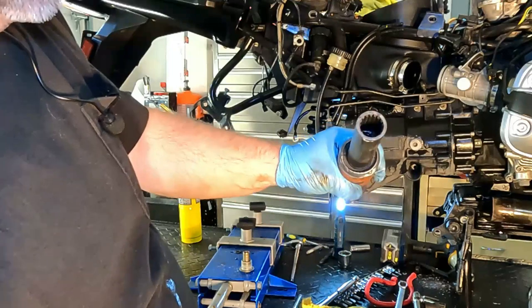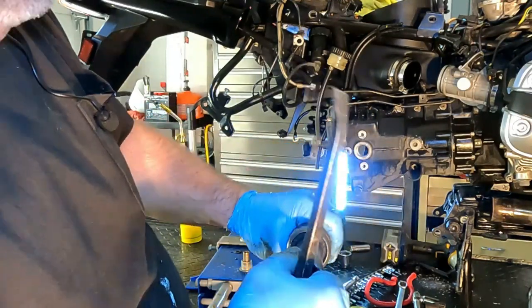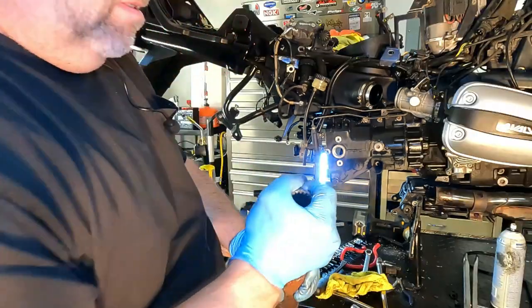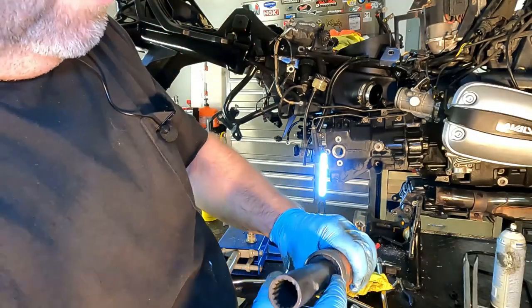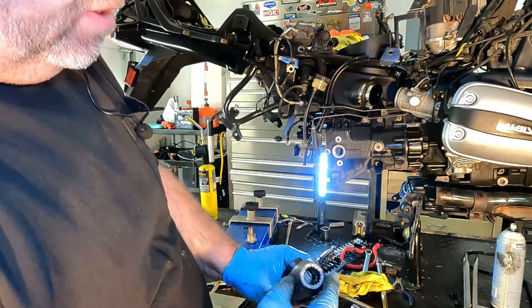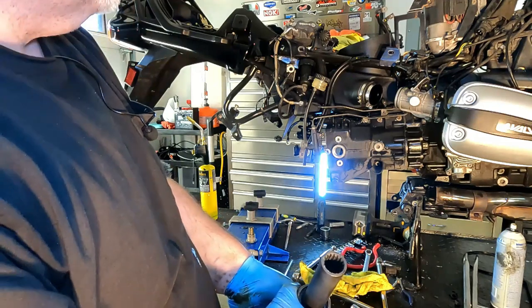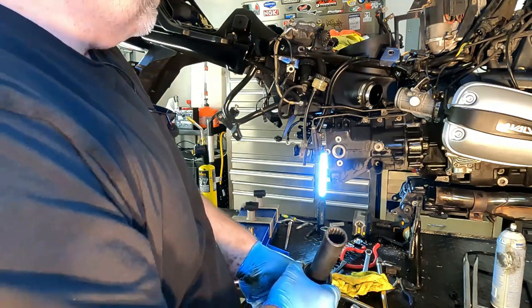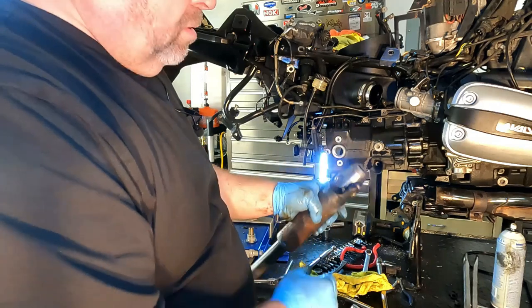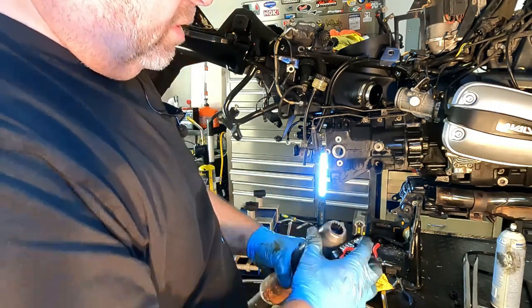Remember I said that the drive shaft could have failed? You see that this part right here is just being held on with rubber. But I would say that these splines have been lubed, so that's a positive sign. Despite the fact that somebody had gone and put back a bunch of thread lock, they shouldn't have. But yeah, the universal joints look good.